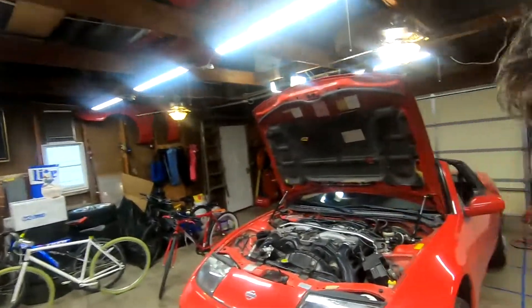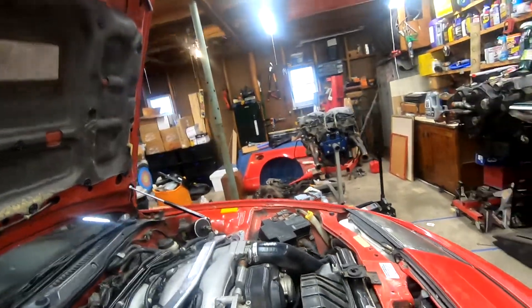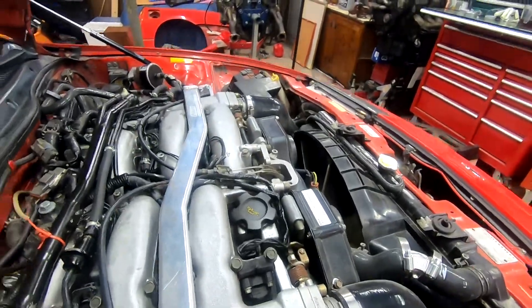Time warp — got the oil filter on. I used a slightly different oil filter wrench, but you can hand tighten it. You can see how many turns I got while turning it, and then just get that seal nice and tight. Make sure it doesn't go on dry — make sure it goes on wet. Fill the oil filter first. When you do an oil filter on these you need to add 0.4 liters into it.